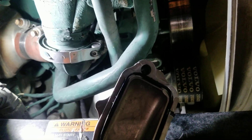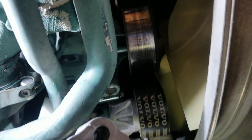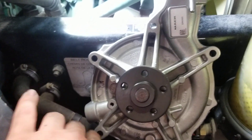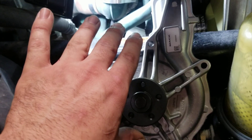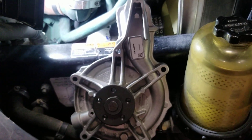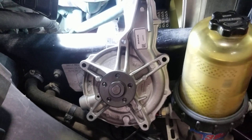Stay away from the housing until you've started some bolts, then push it up against the housing and don't move it — you don't want the gasket to shift. A little trick is to remove the pulley first so you can work freely without knocking anything else loose. Also, when going back together, make sure to put the bottom-left bolt in before you install the pump, because once it's on the housing that bolt requires pulling the pump back out again. Hopefully this helps — if it did, please like, subscribe, and share!